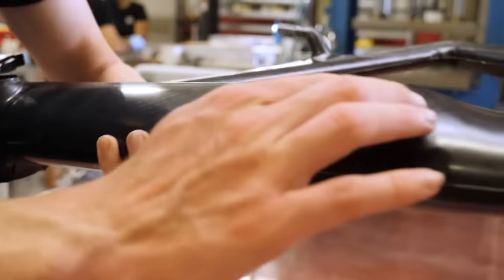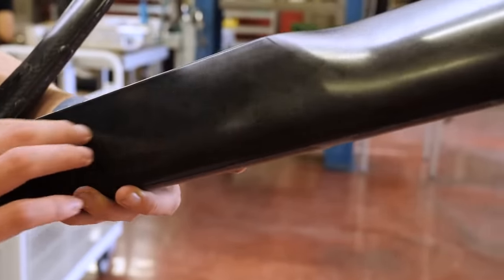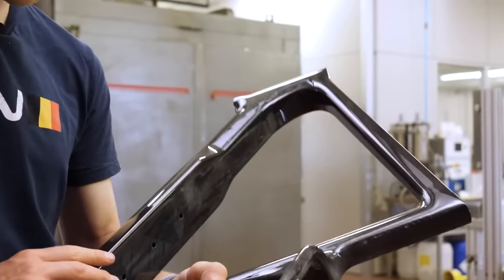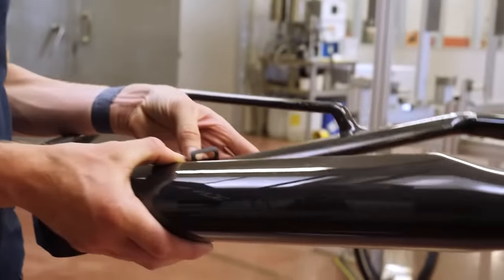Yeah, again, I'm not an expert on the bikes, the composite. I've not come across the raw finish. Is it literally a raw finish, or is it a transparent, clear finish on top of the carbon? Often there will be a transparent lacquer. Yeah, so with the lacquer you can see the weave. But the lacquer is essentially providing the moisture barrier. So if the lacquer is suitably chosen as a moisture barrier, you're going to avoid that problem of moisture penetration, so long as that lacquer is not damaged.